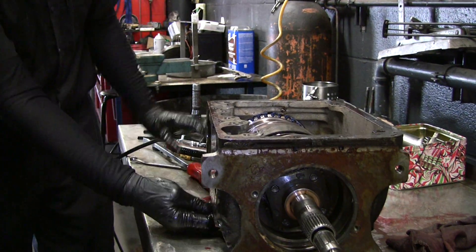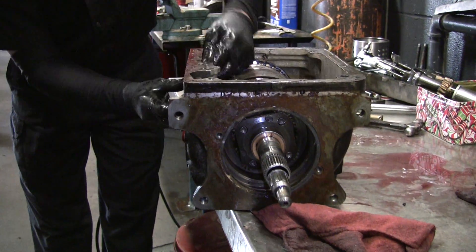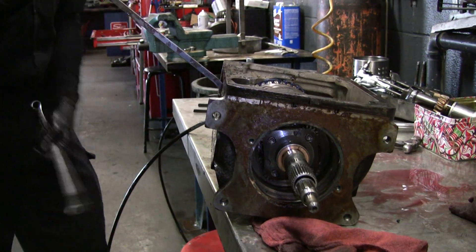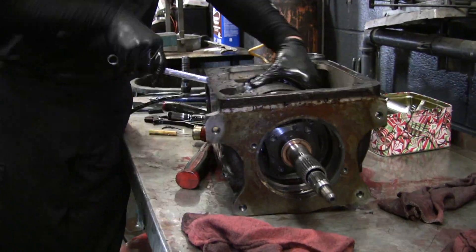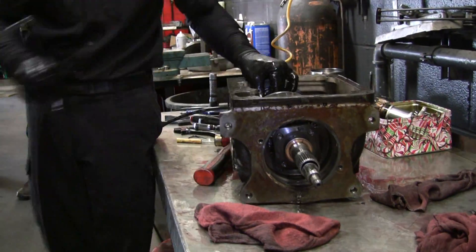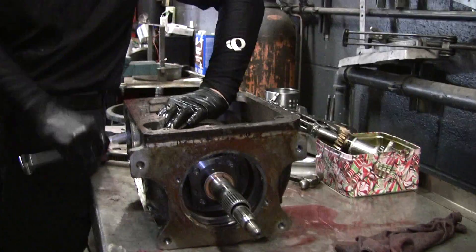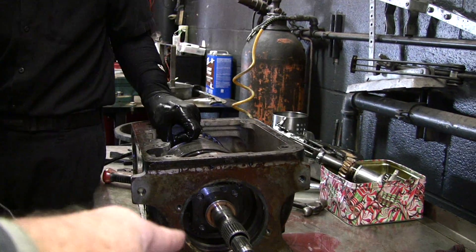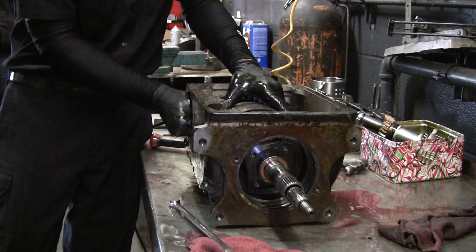Normally you've got to hold that thing. When you're holding the band, it's just so that whole shaft wouldn't rotate, so this drum doesn't turn. But you could just hold this in because that's what's turning as well, can't you? No, that won't hold it. There's a bunch of gears in all that — unless the clutches are applied, it won't hold it. The band holds the drum.